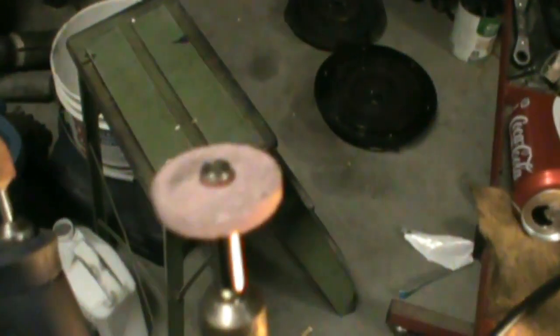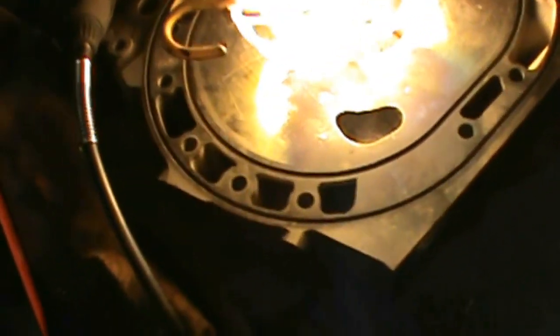For this side I switched up my bit — I'm using one of these cone-style ones. Hit my light so you get the best look. I can just get down in there, get that all shaped good, then start working down this groove to get a nice channel all the way across — these cone bits work out the best for that. You can see it's coming along pretty good, still just a bit left around the edges. I'm just going to work on getting it down in the bowl and getting everything smooth. That factory ledge from the machining is all gone now, so it's not too bad. For doing the runners I have this setup — the handle taken off so it'll fit in there — with these little reamer bit things.